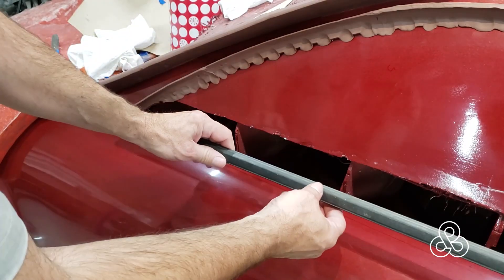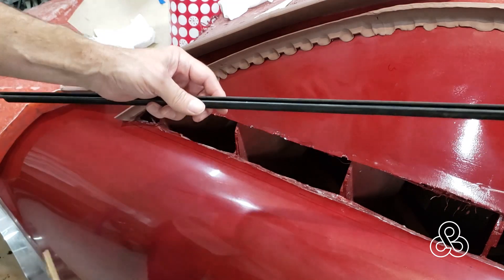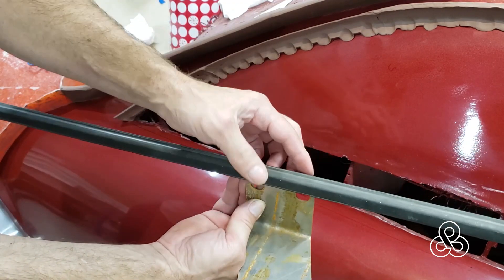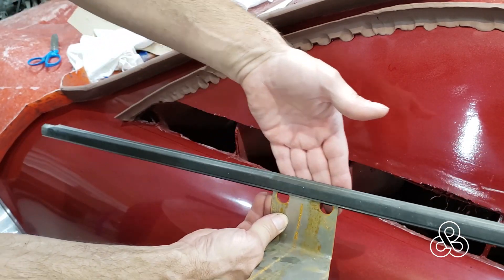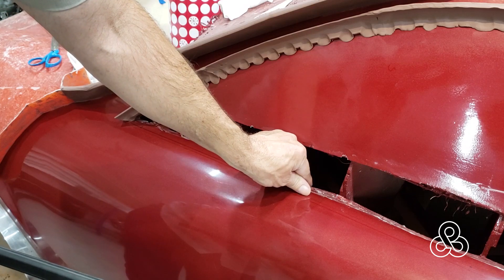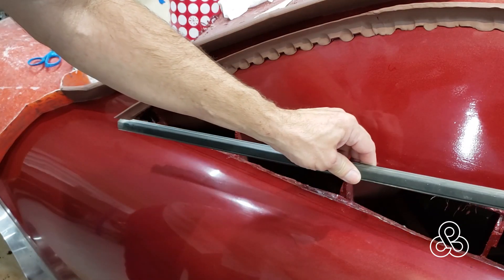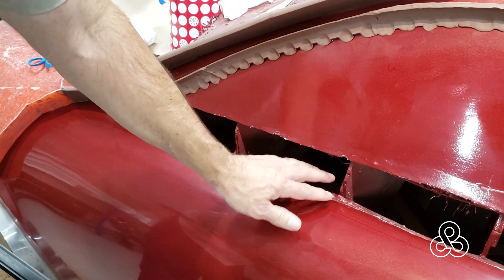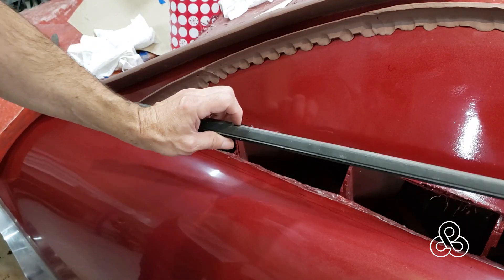I'm going to explain why that needs to have been done. This will have a piece of squeegee trim here which will go up against the window that goes up and down, and that trim needs to fit onto a little piece that sticks up. Between that part that sticks up and the glass itself is about a quarter of an inch. So if I had used this plane — which is the plane of the window — the window would hit about where this black line is. I need to actually step out and create a little flange that sticks up for the squeegee window trim to fit down over.